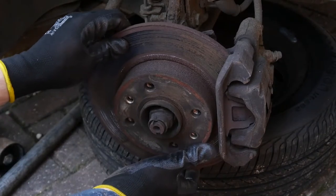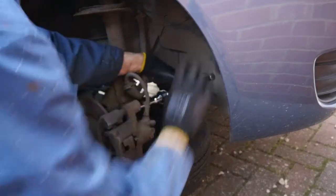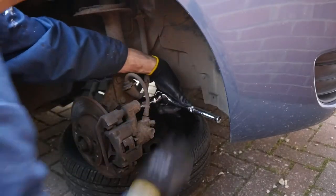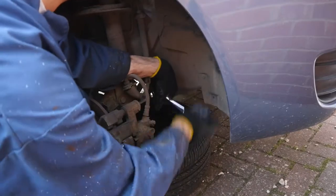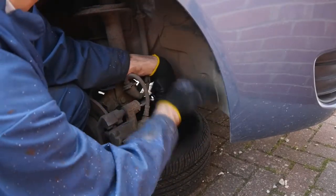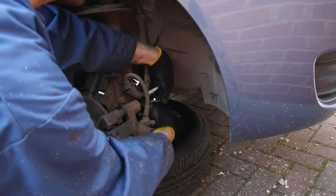Make sure when you put them back on you don't over-torque them. The disc is not seized, luckily. So in some cars you don't need to do this stage, but I'm just taking the caliper off — it's clearly never been off in the life of this vehicle. As it's not too much effort to get it off, I'd rather get it off, have a look, clean it up, then assemble everything at ease. Normally they're only held in with two bolts.